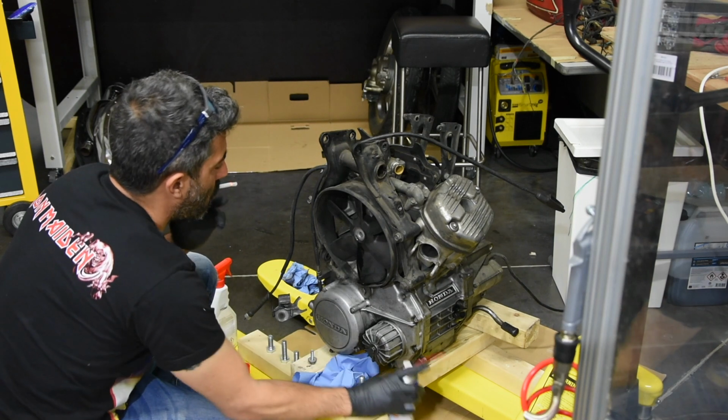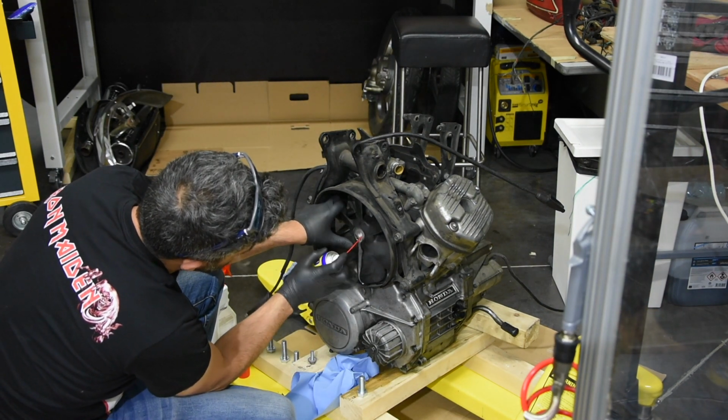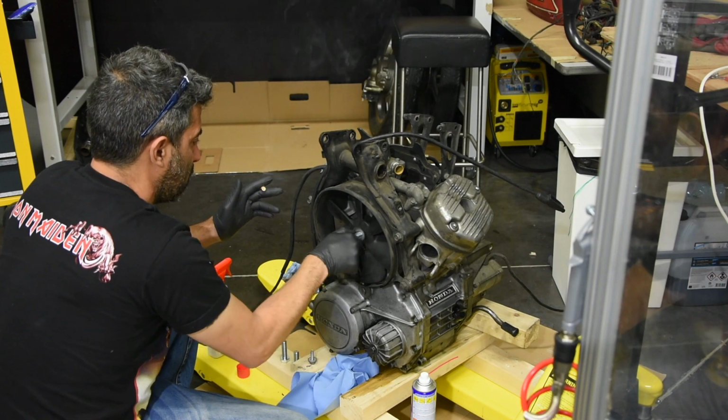Hey guys, this is a short video about the fan, the water pump and the starter dismantling. You can see I'm putting some WD-40, just to give it a little bit more ease to release it. You're putting in an M14 bolt, I think the pitch was 1.5.